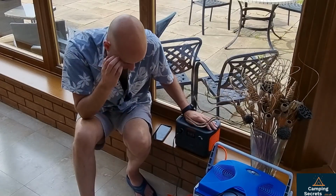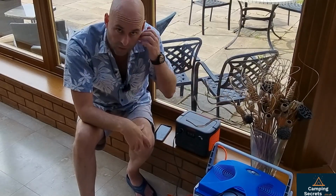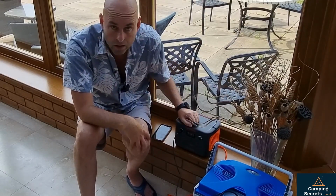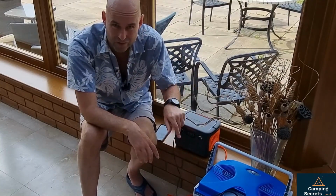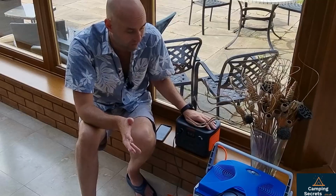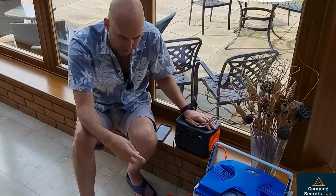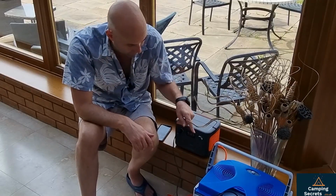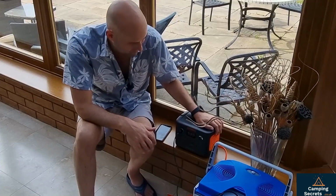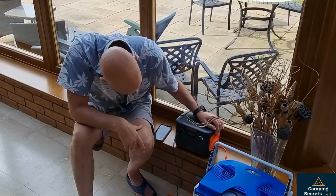And actually it's less power. So 48 watts there for the 12 volt, and it was 56 watts using the 240. And that's probably because there's some sort of transformers in there to get the voltage to the correct level. Maybe it's more inefficient to use the AC input of the cool box. So something to note there, save battery, use 12 volt.